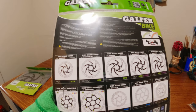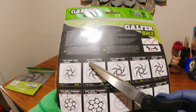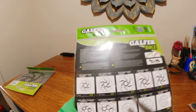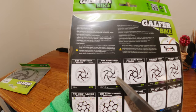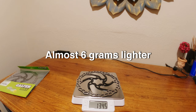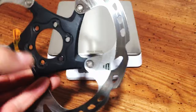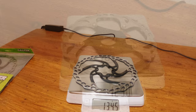On this particular rotor the part number is DBW3W2, which shows 120/140 grams — I'm assuming 120 grams is for the 1.8 millimeter version and 140 grams is for the 2.0 millimeter rotor. This one is coming out at 135 grams versus the stated 140 grams. Now here is the Shimano XT Ice Tech 180 millimeter rear rotor weighing in at 129 grams — that's four and a half grams lighter than the Galfer at 180 millimeters.